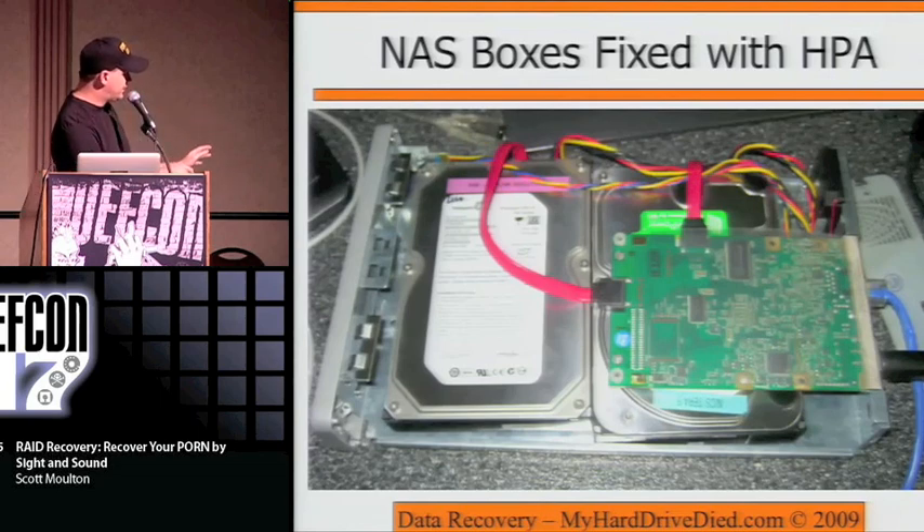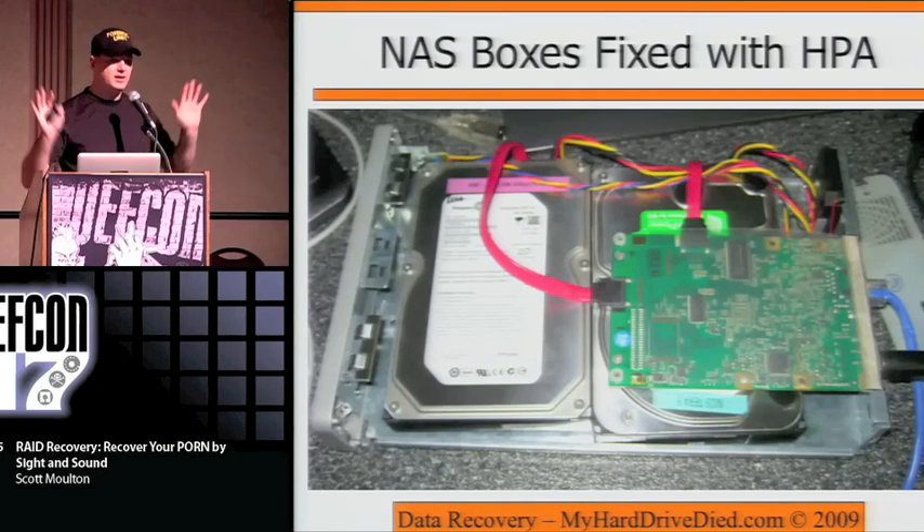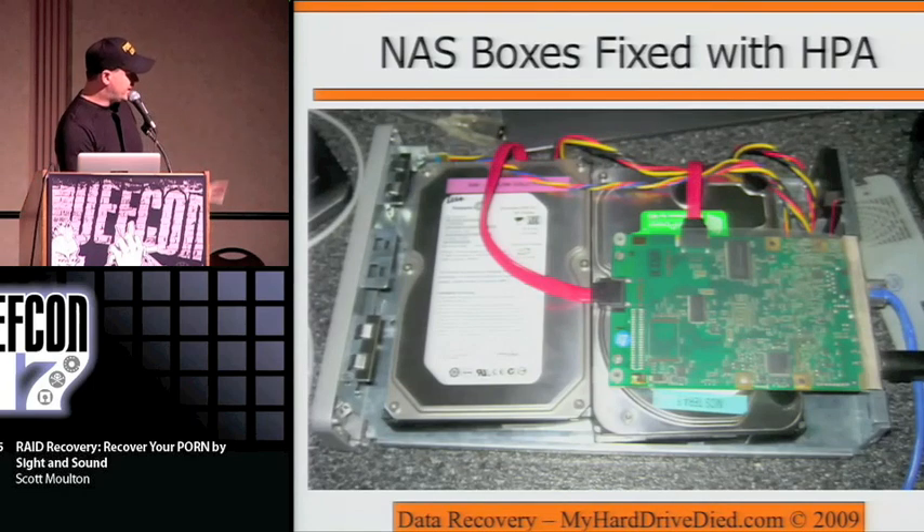What happened here is I had two drives — originally a 1-terabyte array. I had a 500GB drive that was good and a 500GB drive that was bad. I took a 1-terabyte drive and cloned it. But when I put it back in, I need the system with its custom board to do the job, because my whole point is to make life as easy as possible. I could do this in software, but why not let the hardware do it if it's still functioning? So I cloned the drive in reverse using tools like DD Rescue.